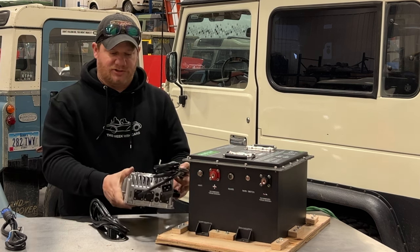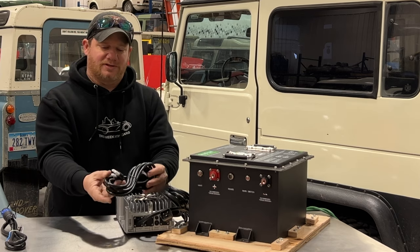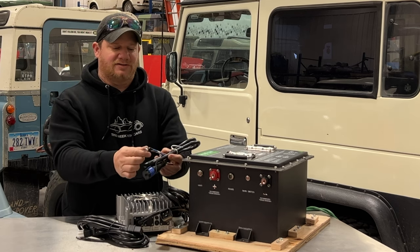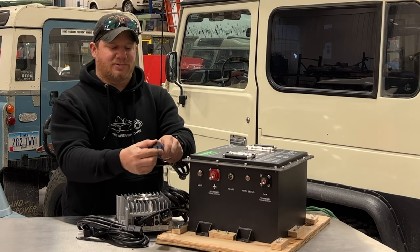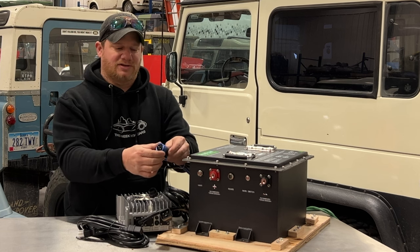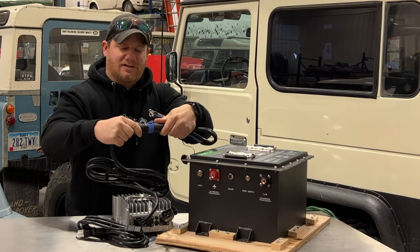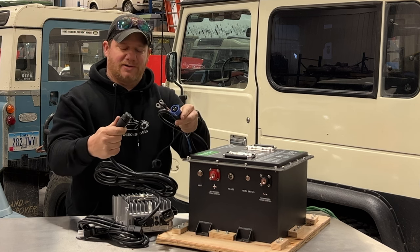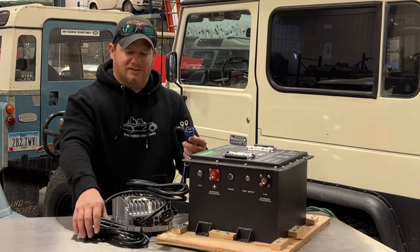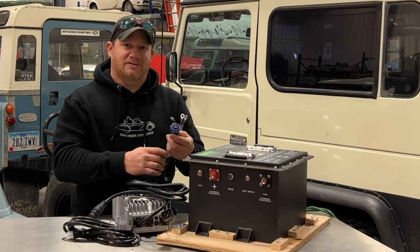The way you would use this charger with a golf cart is it stays at home in your garage. They include a power cord with different adapters depending on what country you're in. On the golf cart itself you mount these terminals to the battery, and then you have this plug that you can access either on a bulkhead or by flipping the seat up. This is a really nice quick-connect to the charger — line them up, push together and it locks, then give it a slight turn and it comes apart again. If you have room you could also mount this charger in the cart with a bulkhead connector, and then all you have to do is plug an extension cord into the side of your golf cart.